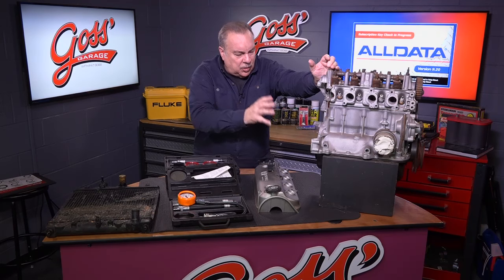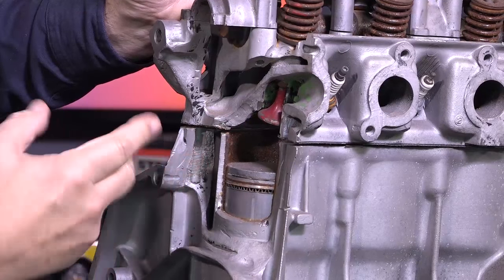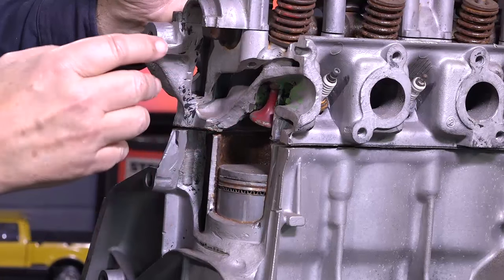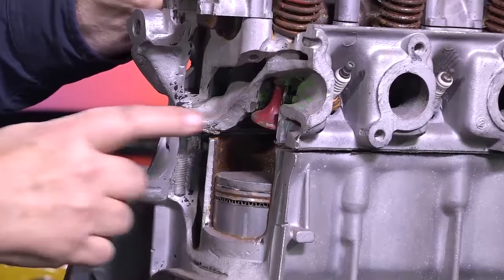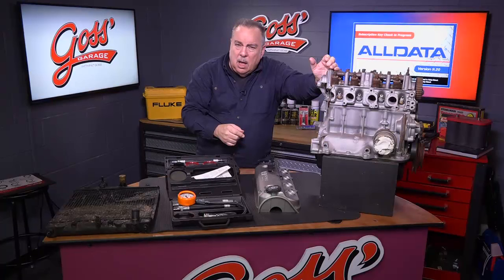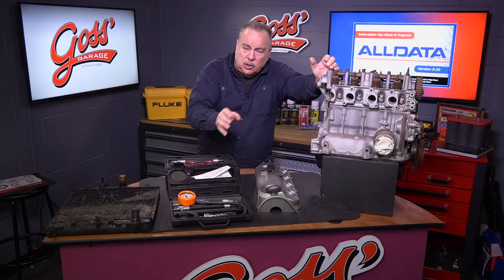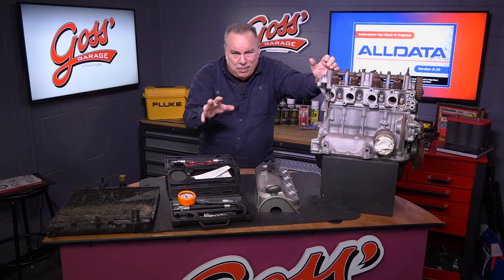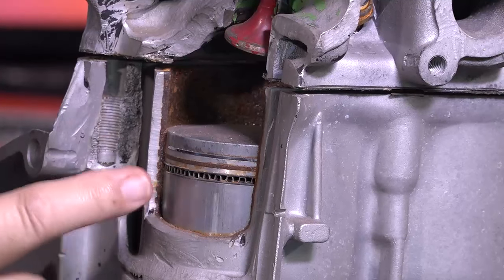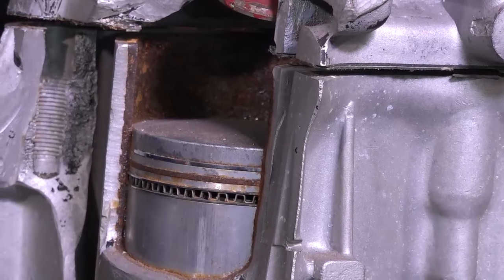Inside an engine, we have a lot of things that have to be essentially airtight. Up here in the top, we have the valves — one or more intake valves that allow air to come into the engine, and one or more exhaust valves to allow the exhaust to go out. When they're closed, they have to be airtight. So if one of them gets a nick in the side of it, it would be a burnt valve, and that would mean a loss of compression. You might see that on a compression gauge, but maybe you don't. Also, here on the piston, we have the piston rings that seal the piston to the cylinder walls to make it more or less airtight. None of this is absolute, but there are specifications that we go for.